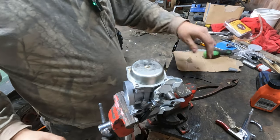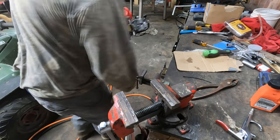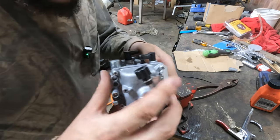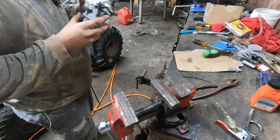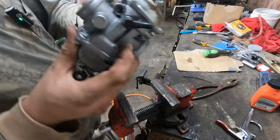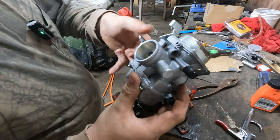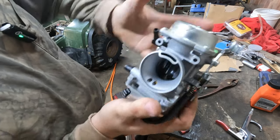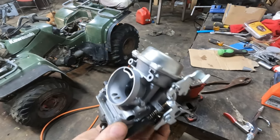That's how you disassemble and reassemble a carburetor. I always do a little test — you can blow in the fuel inlet with the carburetor upside down and no air should go through. Turn it upright and air goes through — that should always work. Make sure the throttle moves. That one is kind of sticky so we'll use the other carburetor. Make sure your slider slides up and down smoothly — if it's getting stuck, something's wrong. Now we'll get it put back on.